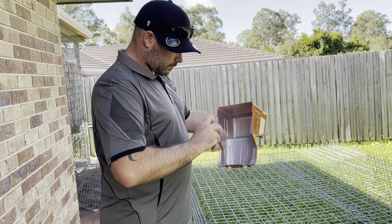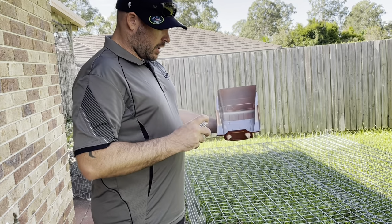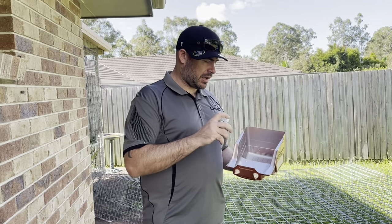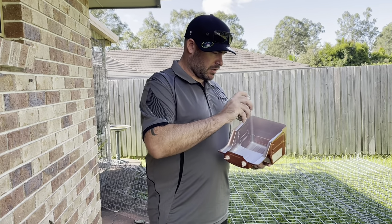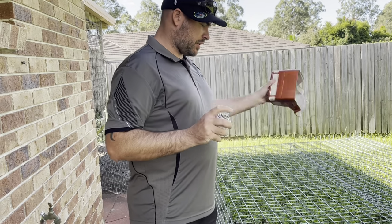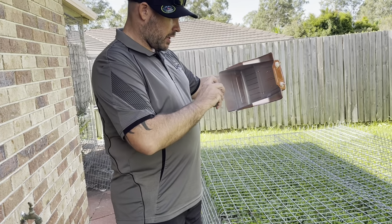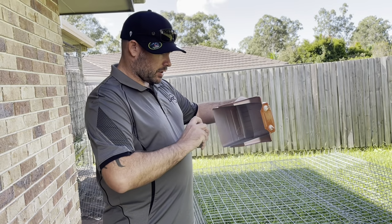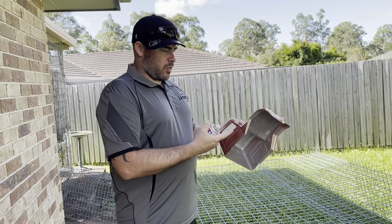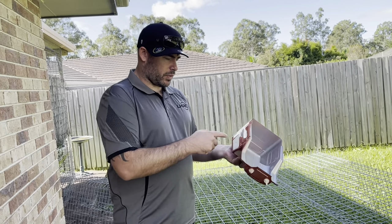Because we're only doing light coats, even just from talking to you guys after letting it sit for a couple of minutes, the paint adhering to other paint is going to happen pretty easily. Again, the trick is not going too heavy in one spot, because as we're spraying this on to the body, it is going to be somewhat affecting the curing of the original color we put down.